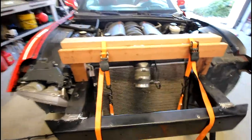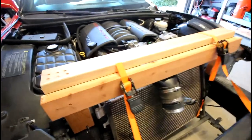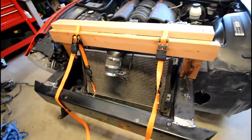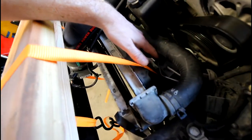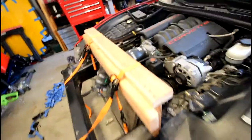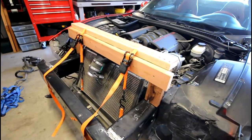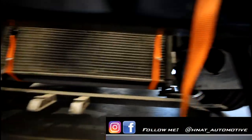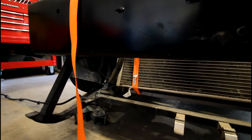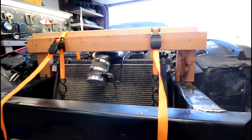If this doesn't say Frankenstein I don't know what does, but I think it's going to be functional. I got the ratchet straps on there — I made sure I fed it down through an area where it's not pinching on anything. It goes around the sway bar, so that's going to be the main grab point on the back side. On this side there's the ABS module, so I made sure I didn't loop around that. The ratchet straps are also out of the way of the fan blades. I ratcheted it up just a little bit — the radiator is raised up slightly on both sides, so theoretically when I take the four bolts out, the radiator and AC condenser should not go anywhere.